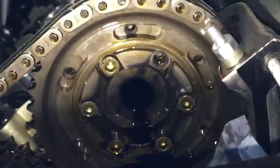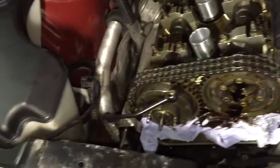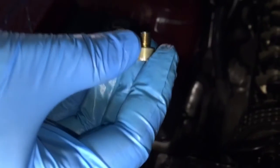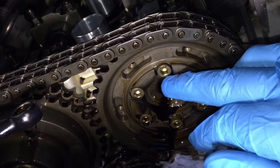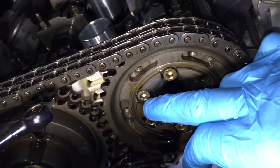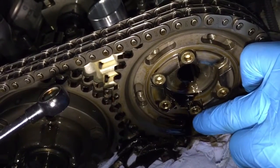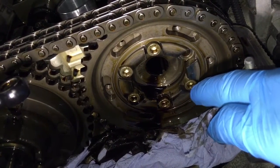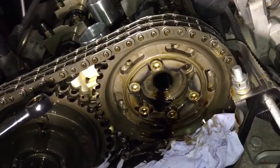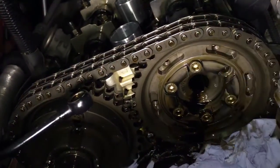If you zoom in you can see the end of the bolt thread stuck inside, and then the piece that snapped off is here. You'd think the other five would be holding sufficiently, but in this case they're not, which is causing the rattle. This one's loose, this one's loose, this one's undone. The bottom one's very loose, possibly even snapped, looking at the amount of rock on that, and then the last one is also loose. Amazingly it was holding on with not many of those six bolts, and that looseness was causing the rattle because it's no longer clamped tight.